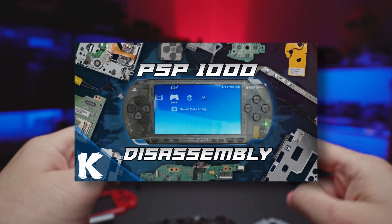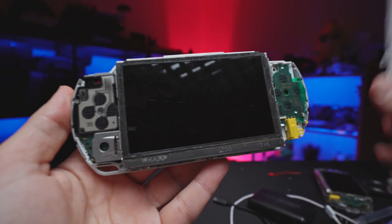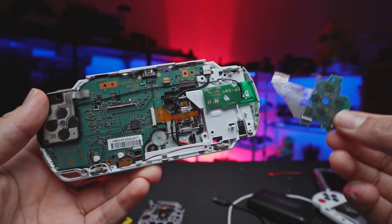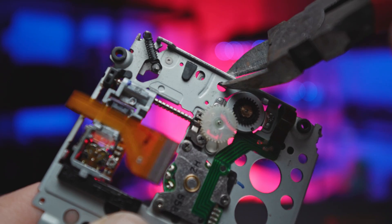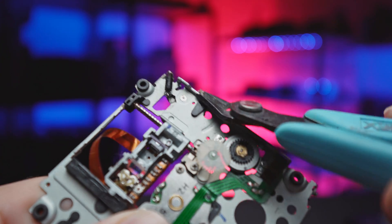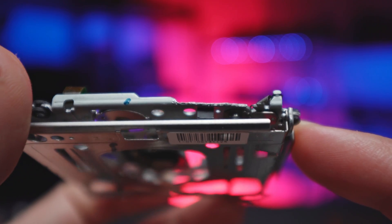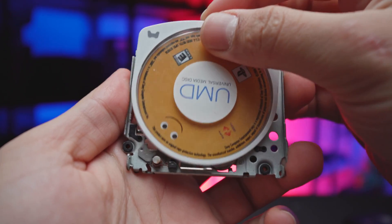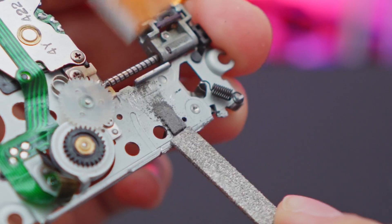The first thing you want to do is take apart your PSP — I have a disassembly video in the description. Remove the faceplate, the subframe, the UMD drive, and finally the board on the right that houses the power button and face buttons. Then remove this piece right here: get a strong pair of snippers, create a gap, and keep moving it back and forth until it snaps cleanly. Clean it up and file down this plastic piece that keeps your UMD from going too far, so this area is completely flat. Once done, set the UMD drive to the side.